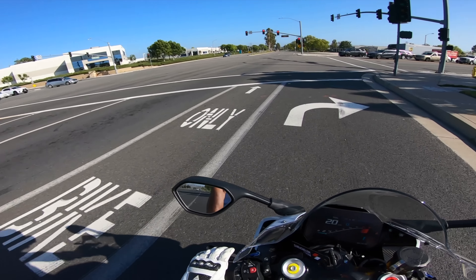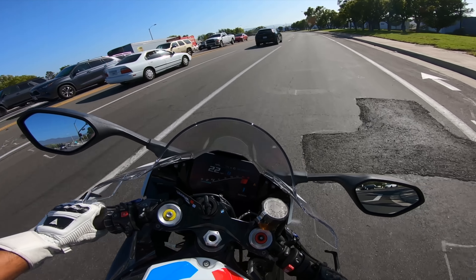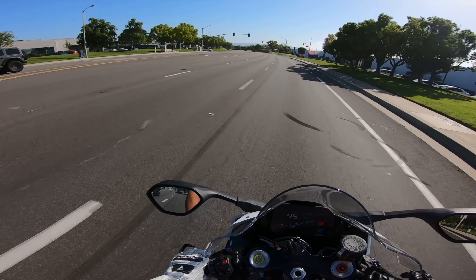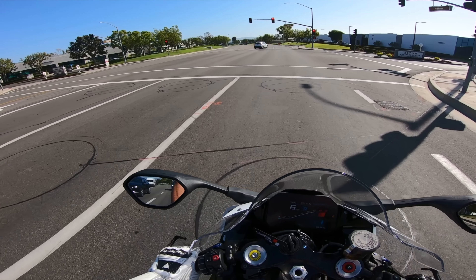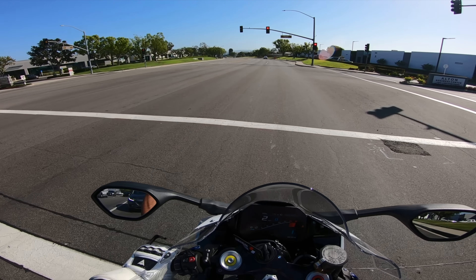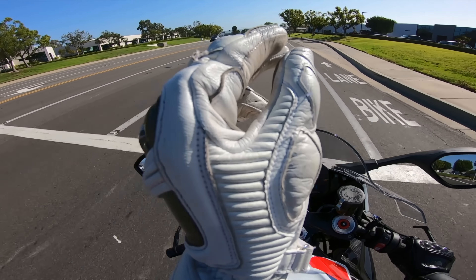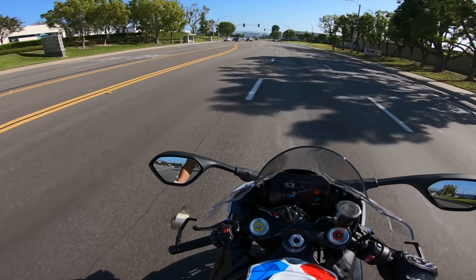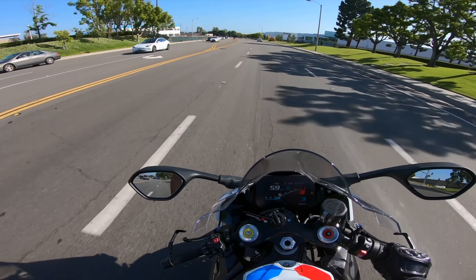The TST tail tidy comes in more pieces than usual and you have to connect the wires and seal the connections, mainly because the connectors for your turn signals and lights — they don't want you to drill holes in your fairings to make it fit. So there's a small hole, and that's why they kept all the cables loose so you can fit them through the bolt holes. Then you plug in all the wires and heat seal them.